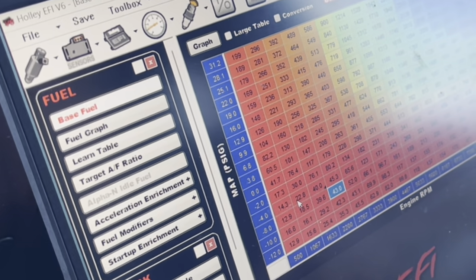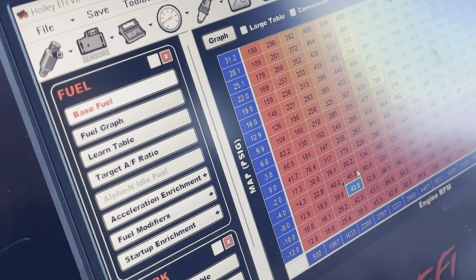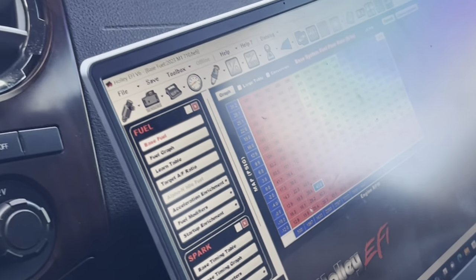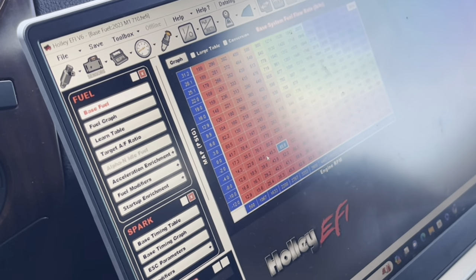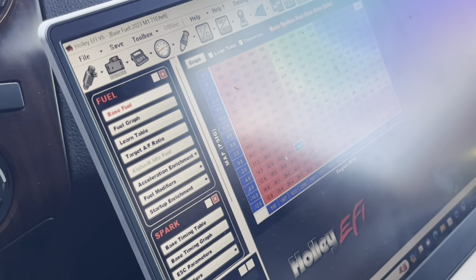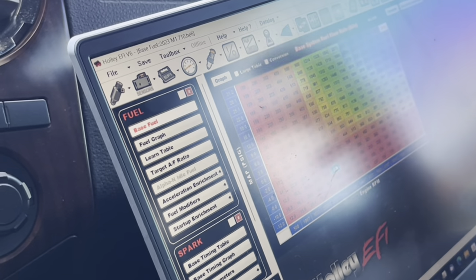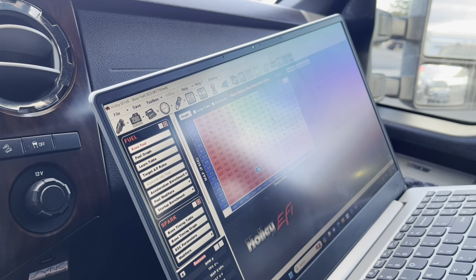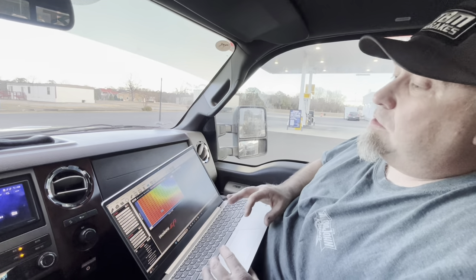What kind of vacuum does this motor pull when it's out? Down here at minus 12, minus 10, it's not going to be there - it's going to be somewhere in this minus 2 to minus 4. It depends on how big the cams are and how high the engine is idling. I think we need to not mess with this right now because the car cranks up and runs good. When it's idling and the blow-off valves are open, it's essentially like a turbo car - the turbo is not spinning, just aspirating, not making boost. We've modified this table back to where it's good, so I think we should leave this table the same.